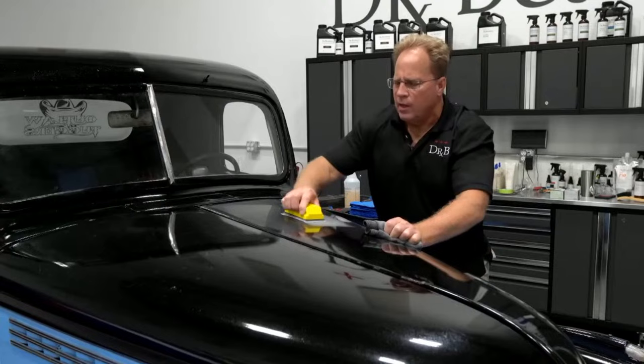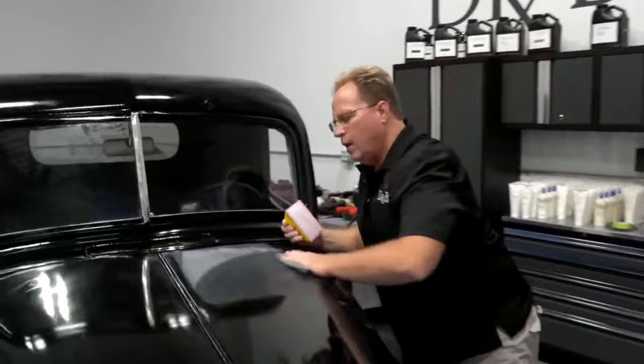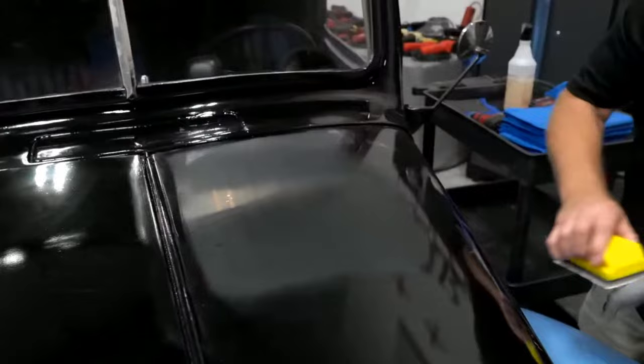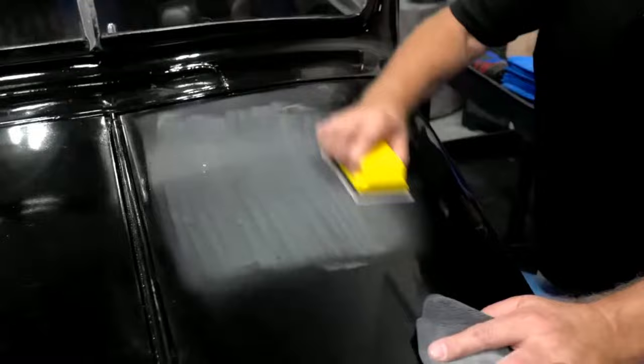But Rich Evans taught me, if you start out sanding with, I think we were starting out with 1,000 grit, then we went to 1,200, then to 1,500, then to 2,000, then we started buffing. Now I want to see, can you see these lines through here, this pattern? Yes. Okay. So that's a fairly tight pattern, but I want to keep it even tighter. Okay, so you don't even see those lines. That's by just barely moving over, like 3/8 of an inch at a time. Okay, so that is a nice tight pattern.